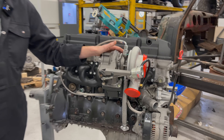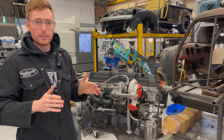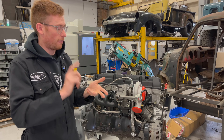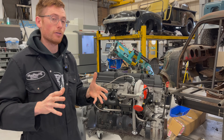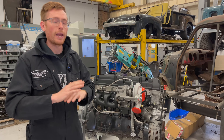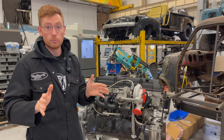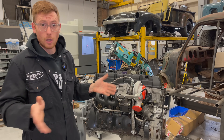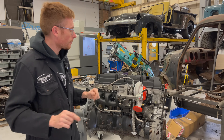The first thing to get out of the way: you do not need any kind of oil pressure restrictor on the HX30, HX35, HX40, S200, or S300 — those are the turbos I have a lot of experience with. You don't need an oil restrictor on any of those. I often see that question on the forums and the answer is no. The simple line kit we supply works fine, doesn't damage the bearings, doesn't cause any problems.